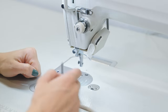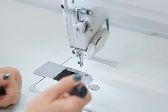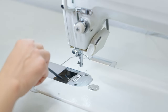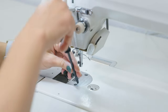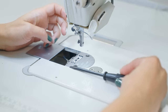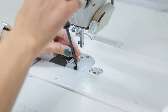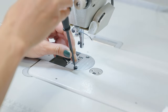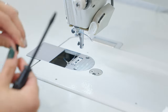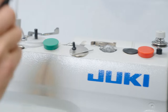We've got two pieces to our throat plate here. This little guy is like a secret trap door. This allows us to see down into the machine without lifting the whole head up, which we are actually going to do this time. But it can help when you're trying to see just the bobbin casing from above without getting under the machine. These screws can be a little hard to unscrew because they are totally flush against the machine — you don't want fabric getting caught on them. I get them far enough that I can unscrew them with my hands, then keep a magnet on top of the machine to pop those on, along with the needle, so I don't lose them.